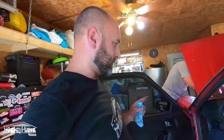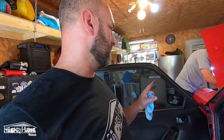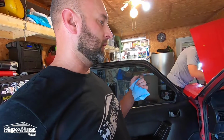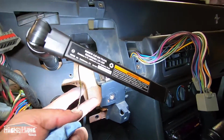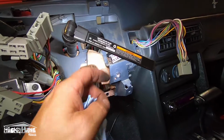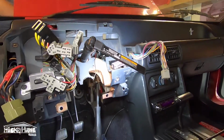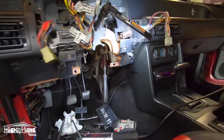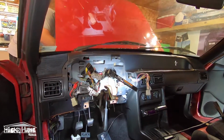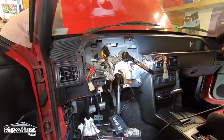All right, guys, one of the most difficult things we've had so far is relocating the speedometer cable, but what we figured out is the best way. We tried pushing it through, it wouldn't come through, but what we've done, let me show you here, we'll get the light on. Took this clothes hanger, we pushed it through, and Jesse is taping the speedometer cable onto it right now, and I'm gonna pull it on through. As of right now, this is our best option. I think this is the best bet all the way around. But you can see we got 3 pedals. We're getting closer.